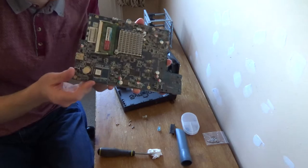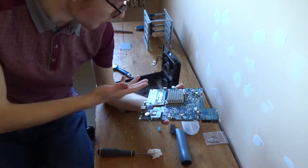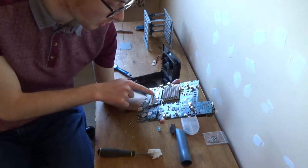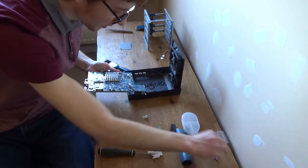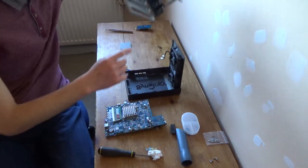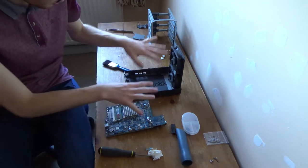This is the reason why I give stuff a full teardown, especially second-hand electronics — as you can see there is just dust everywhere. Also, in the process of disassembling it, I've figured out how you upgrade the RAM. What's currently in here is two gigabytes of DDR3 and it can support up to eight gigabytes of RAM. I've put this cage back together and reattached the hard drive PCB to it. Here's a little USB and eSATA interface PCB which I haven't yet put back on because I'm still working on these bits.